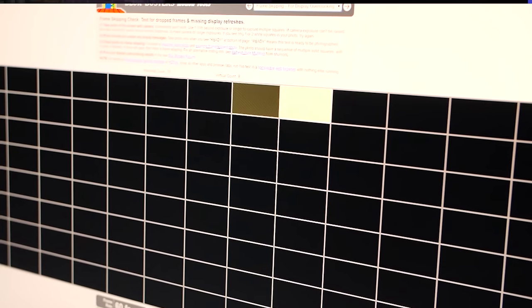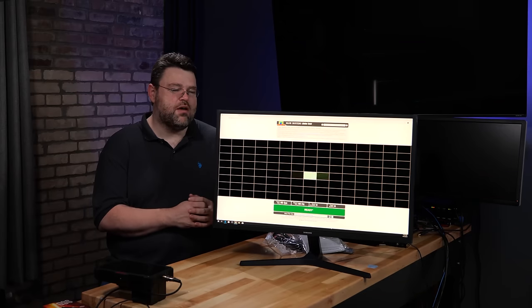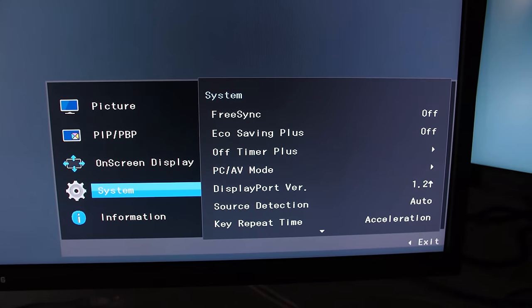In the high-speed footage you look for situations where two boxes side by side are fading or flipping — it's really the way to measure panel response. On this panel there's a little bit of a green tint in the uncalibrated state; after calibration it looked more like I'd expect, so out-of-box color calibration is going to be a little all over the place. This new monitor also supports FreeSync. The FreeSync range at 4K 60Hz runs from about 44-45Hz up to 60Hz — it advertises 42 but you really want 45-60. The range is a little wider at lower resolutions, but it all tops out at 60.